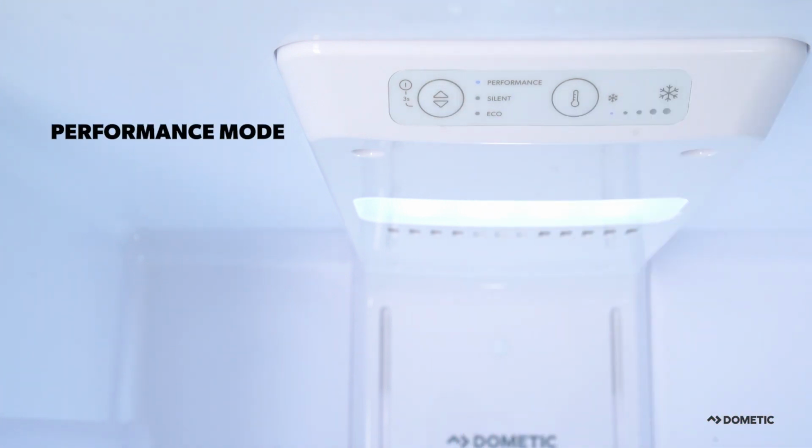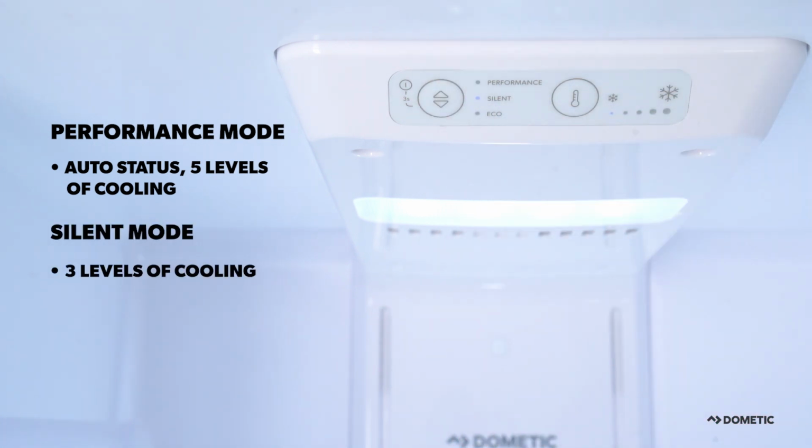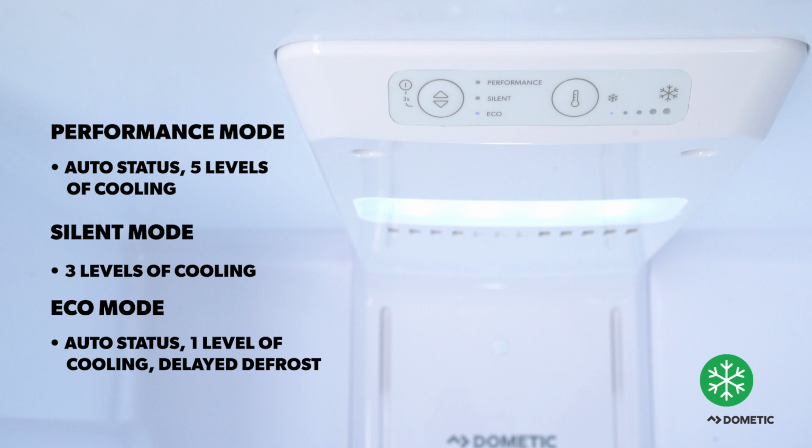In performance mode, the refrigerator works in auto status, with level 5 producing the coldest temperatures. For silent mode, choose one of the 3 lower temperature settings. And finally, in eco mode, the refrigerator works in auto status and only at temperature level 1, with a delayed defrost cycle to reduce power consumption and conserve battery life.